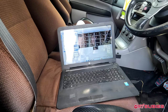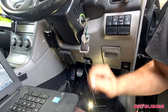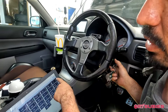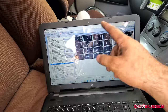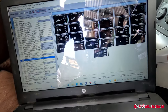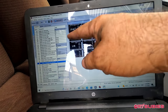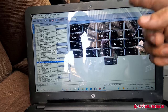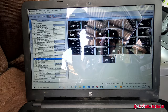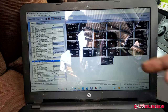Now we go back to ROM Raider. Unhook the green connectors from underneath the car, then turn the ignition off completely. Now connecting and reading data — we are logging the ECU and its parameters. When doing an e-tune, your tuner gives you a specific list: log AFR correction, AFR learning (short-term and long-term), OEM AFR reading, closed-loop vs. open-loop fueling, engine load, RPMs, knock sensors. You can save this profile so you don't have to re-select everything each time.